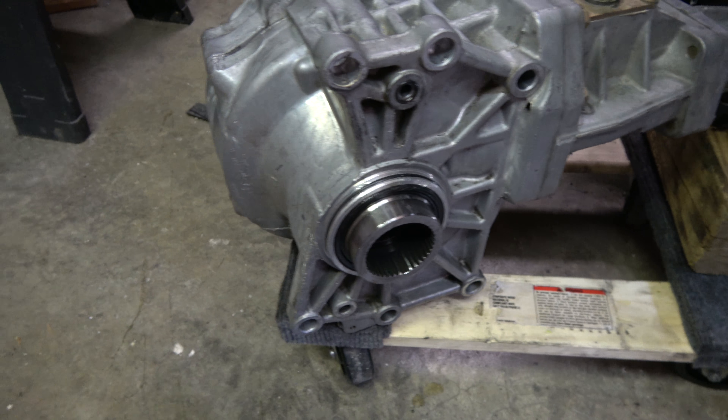Don't forget you have this engine mount on the back — that's 34 foot-pounds. What I did to get it in there was take a taper punch. The engine was leaning towards the back a little bit, so I put my hand there, pushed down on the whole engine, and when those holes got close I took the taper punch and slid it in, then got my bolt and slid it in from the backside. The drawing shows the bolt going in the other direction, but I know this engine will probably come back out in the future, so it's just easier to get to the nut and knock the bolt out that way.